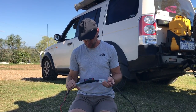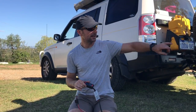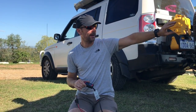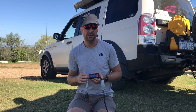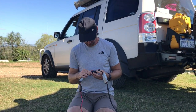Normally I don't plug this in like this — I actually just hang the watt meter directly inside the Anderson connector in the toolbox. That way, as soon as you open the lid you can see both the battery monitor at a glance and this screen, which lights up as well. So when you're looking at it in the evening, as soon as you open that box you can see the display.